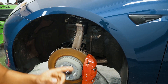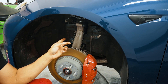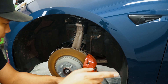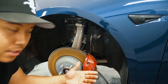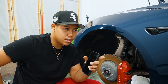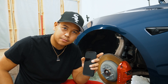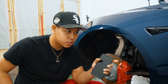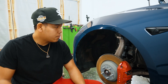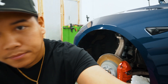To recover on the top hat mount — you just need to take out those three 13s and it pops right off. You don't even need to spring compress the front struts. The orientation for the arms is that it's a horseshoe shape, comes down and around, facing towards the back of the car on this side. Pretty smooth install so far. I just finished the fronts, so now I'm moving on to the rears to get those knocked out today. Tomorrow I'll run airlines, height sensor wires, and start planning where to mount the ECU and management components.